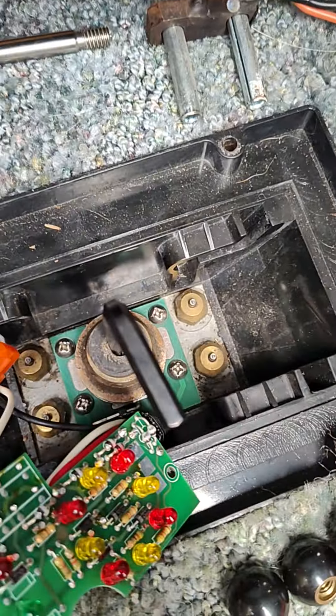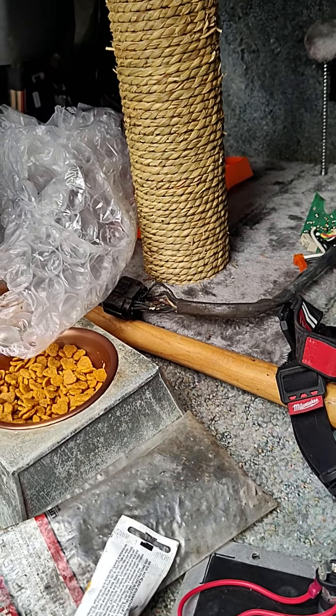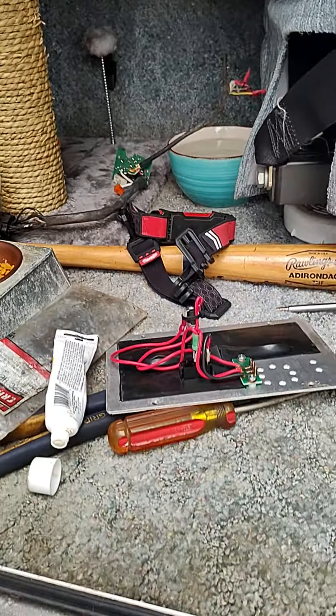Run it through this wire — there's a little hole down there, it's dark, but the pigtail sticks out. I've already noticed this pigtail is different. This is for the PSP assembly 210 and 225 panel, and mine's a 210 HWH leveling system, so I'm assuming that's why there's an extra wire in that loom. That loom is for the leveling of the unit.